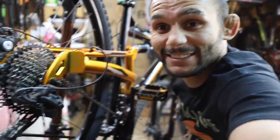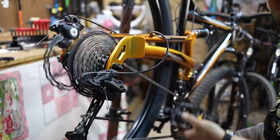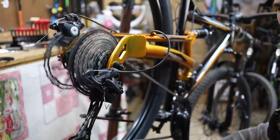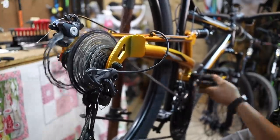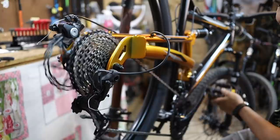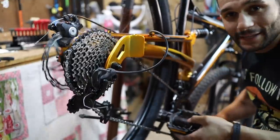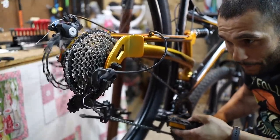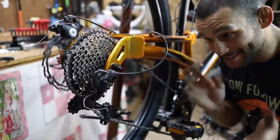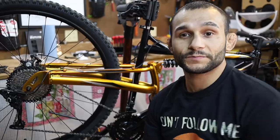Let's go for the second chain ring. We are now on the second chain ring in 10th gear. There's ninth, eighth, seven, six, five, four, three — holy crap — two. A little messed up. So it's limiting out on this one, you can see where it's starting to collide. Hey, one out of three — I guess that's not terrible. One out of three is not too bad. I just can't pedal on that one or I'm going to bind.